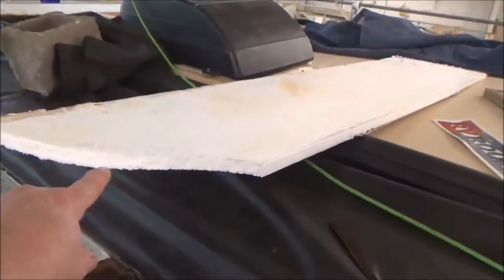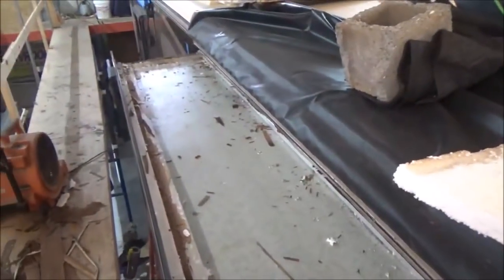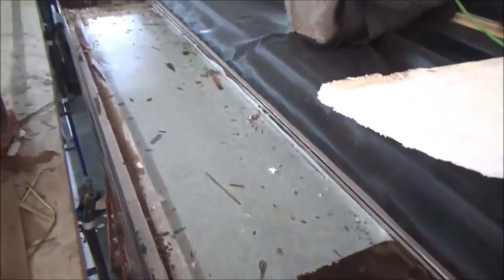This is the old roofing right here. That's the decking there, and then it was sitting on that applied foam — that's how they laminate it all together. We're not going to put a regular rubber membrane — we're going to make a whole sheet metal roof for it. That's what we're working at so we get our measurements right. We'll make it all in one piece. It'll be nice cocoa brown, real close to this color on the side. It'll look good.